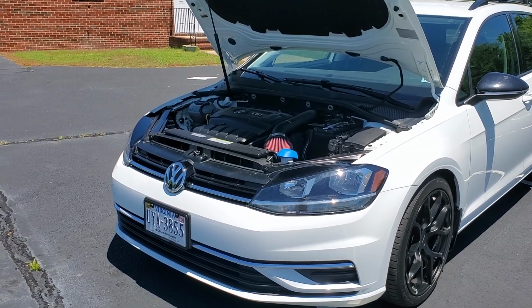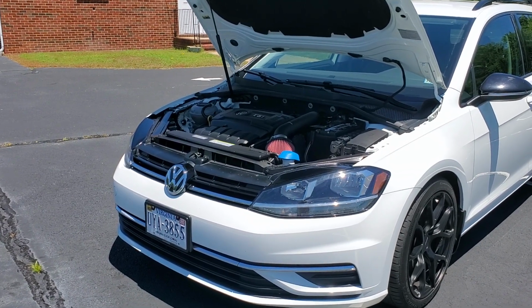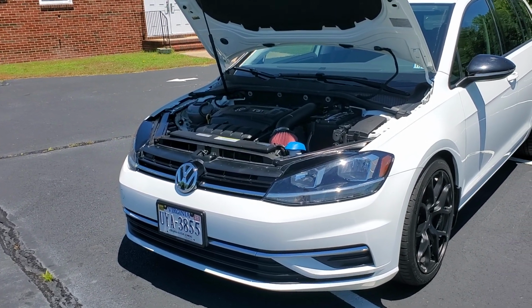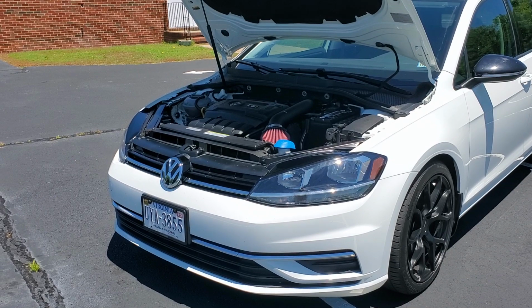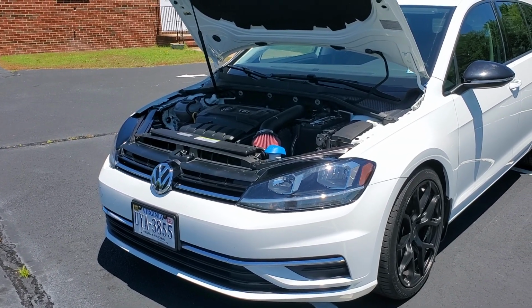They work. I like that they match the look of the daytime runners. I think they're brighter. I do think they throw a little bit further. So overall, I'm super happy. You're not blinding everybody. The deAuto bulbs have the diodes in the right location to mimic the filament in a halogen bulb, which is, of course, the drama with some LEDs, which have diodes in the wrong location and do throw light in the wrong location.